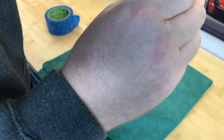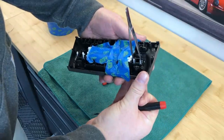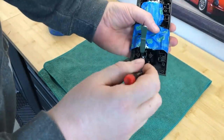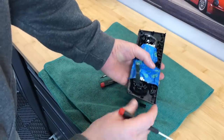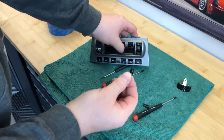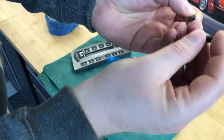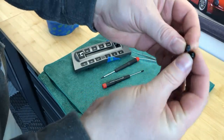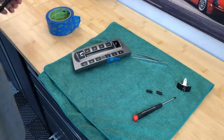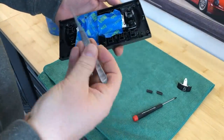That seems to be doing the same job — and now they're holding in without falling out. Now I'm going to use my Torx screwdriver to push the bottom plunger. You can see the button there is slightly proud from the front. I'm now going to turn it round and try and do the same — pushing the button down slightly so you can see it's just over the edge, and now I'm going to push this second plunger down as well. And there we have it — the old button is coming out, and the two plungers are also supposed to come out. The plungers have a slight ridge in the middle, but essentially they're the same on each side, so they'll go back in once I put the new button in. I think I should copyright or patent this tweezers method because it works a lot easier than those two little screwdrivers.